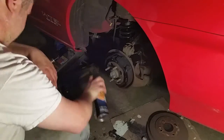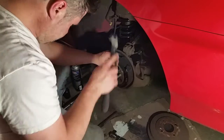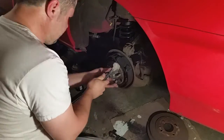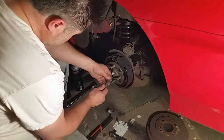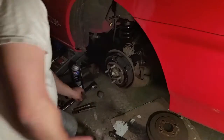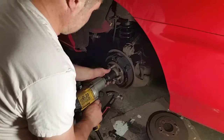Now that the drum has come apart, I'm going to take some brake cleaner and clean that off. Then we're going to use the chisels to work the dust cap off, working around it and using the hammer to pry the rest off. Then we're going to use the chisel to open up where the axle nut was crushed down on the hub and shaft.